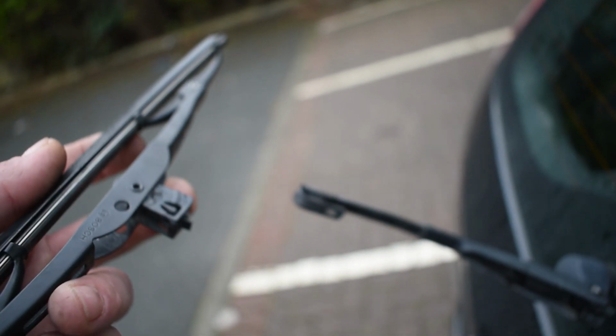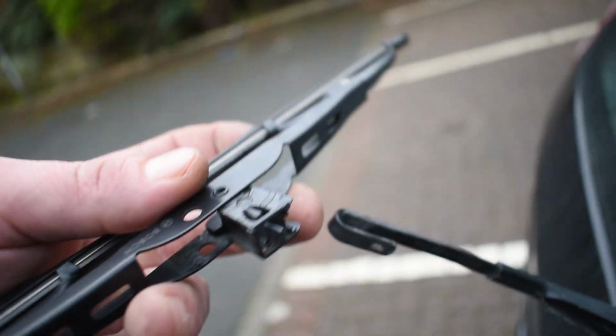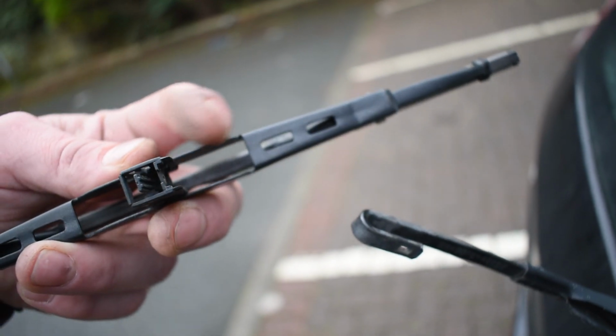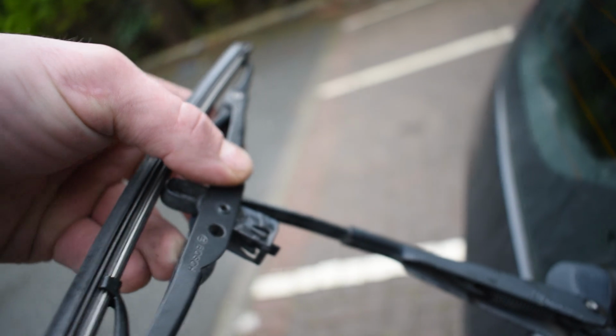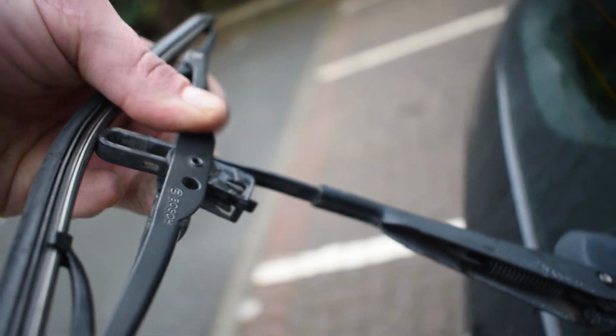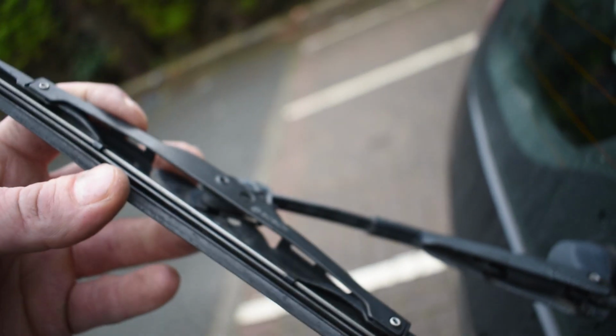So you're going to get your new wiper like this. You're going to slide it into the hole which, looking down it, is the right hand hole where my index finger is. And slide it through like so, and then pull your plastic bit back up and clip it in. You heard that clip then, and that's your rear wiper reinstalled.